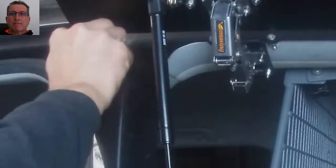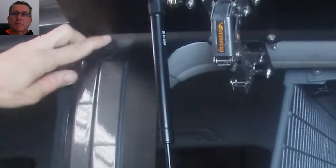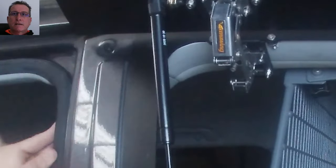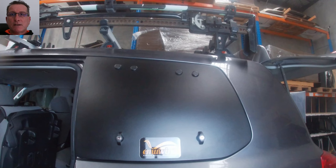There are a couple of little clips in your kit — these just cover up these holes. Feel free to use a little bit of glue if you wish, generally we don't. Sometimes the holes get bent with the tool we use to remove the window, and we do need to use a little bit of glue in there. And there we go — we've got a pretty much complete EMUing, ready to go. All you need to do is get some heat into that door panel while it's closed to ensure that weather strip has been heat set. Give it a few days for the glue to fully cure, and we're all done. We've now got great access to the back of our car.